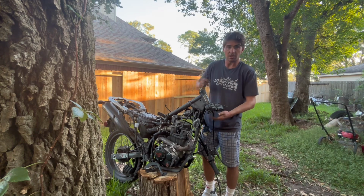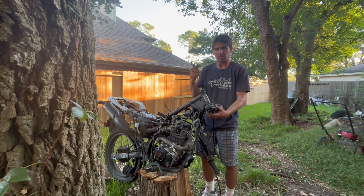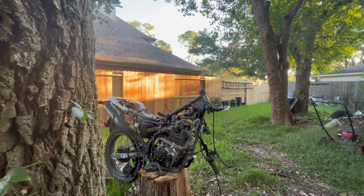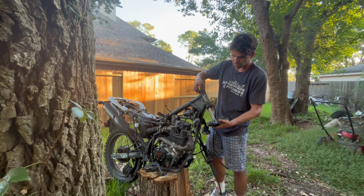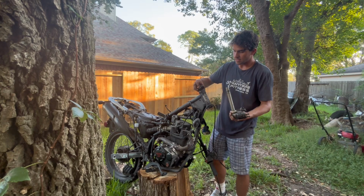So again, this spins off. Now, when you spin this off, support the bottom, because once this thing threads out, it'll fall right out the bottom, and there's a bearing on here you don't want to disrupt or break. So just unthread this collar. If you want, pick up on it to help it. Just unthread this collar here. And now boom, it's gonna fall out for you. Right? Perfect. Now, this top piece comes off.